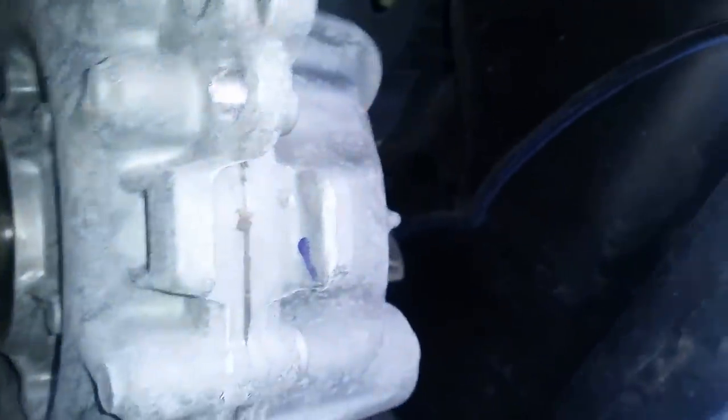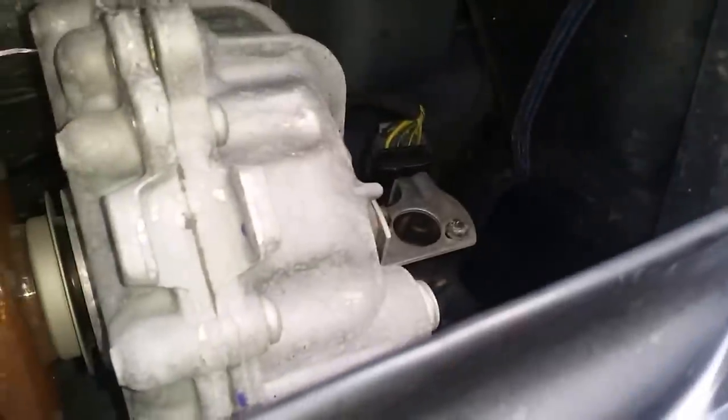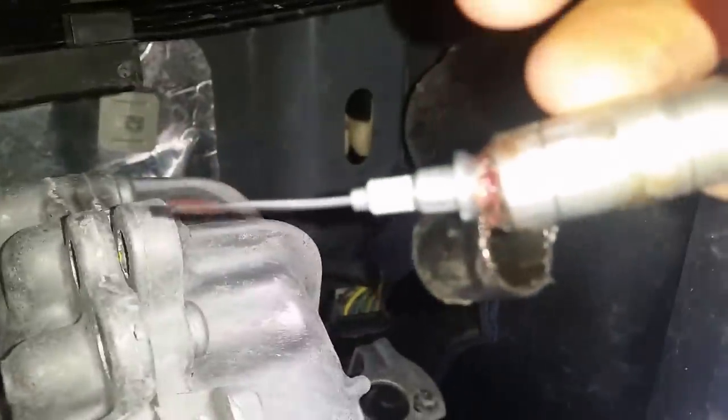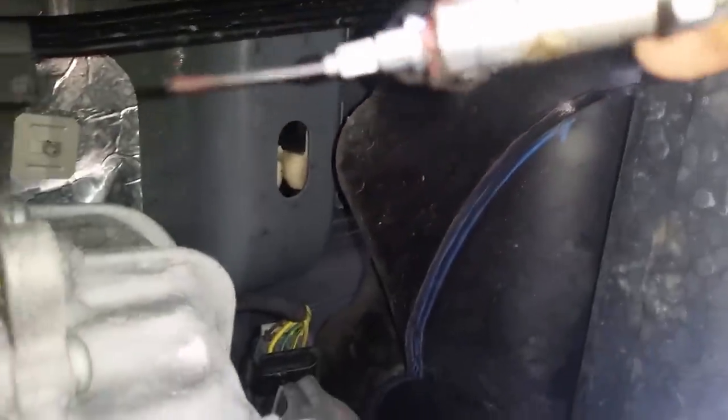Just in front of that divot is the grease point — there's a good shot of it right there, it's just a tiny little guy. Your regular grease gun isn't going to hook onto it. It's got a little hole in the center with a ball and a spring, but it's not the type of grease zerk that's on every other vehicle. So you need to go to your auto parts store and buy a needle that fits into your grease gun. They make two types: one like the old chainsaw pump style with a hole in the center, and one that looks like a syringe — that's the kind my parts store had. It just snaps into the grease gun and had a really sharp point, which I ground off.